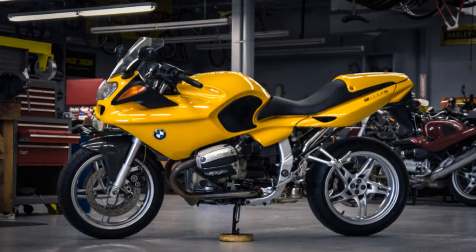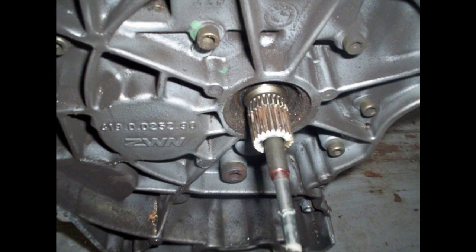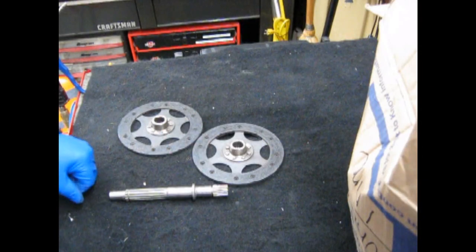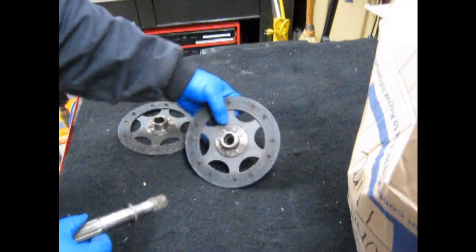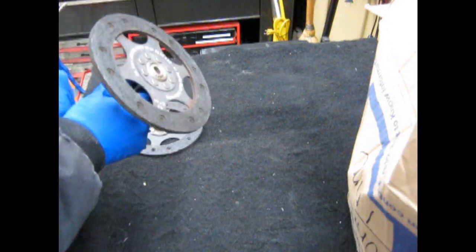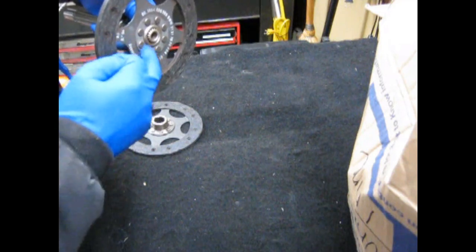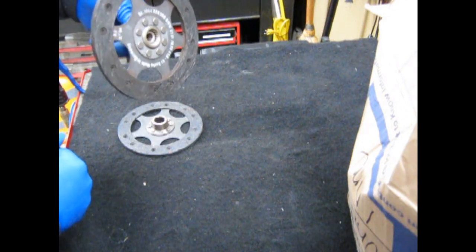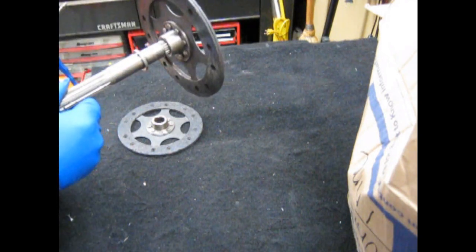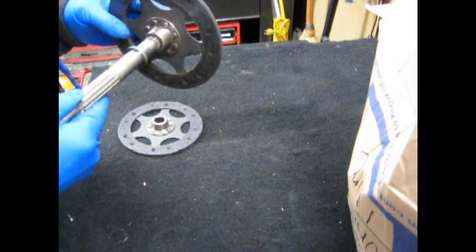Issues with these bikes are few. They can strip the input shaft splines on the transmission to the clutch — that can happen. When BMW decided these should all have a hydraulic clutch, somebody messed up. Normally, K bikes, all the 1100 bikes, 850s, et cetera — your clutch would sit on the shaft with a little bit of the drive shaft protruding through the clutch. When they went to the hydraulic clutch, they messed up the measurement. You're not utilizing all of the splined area on either the clutch hub or the shaft. These tend to strip anywhere between 7,000 and 24,000 miles.